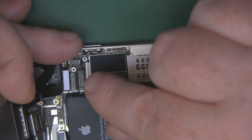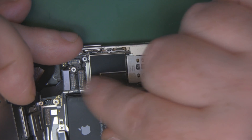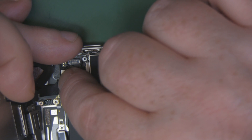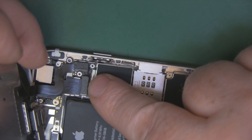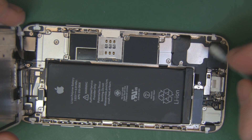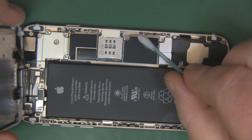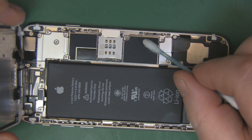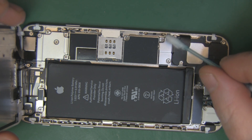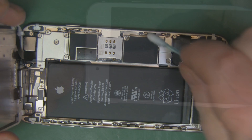When connecting the little ribbon cable connectors, it doesn't need a great deal of force — sometimes you'll feel the click through your finger, sometimes you'll hear it. If you're having to use too much force, you haven't got it lined up correctly. Put the shield back on with the screws to hold everything in place. Just before fitting the screen back onto the iPhone, use a cotton bud dipped in isopropanol or surgical spirits to clean around the edge of the frame, removing any grime so the screen fits flush.